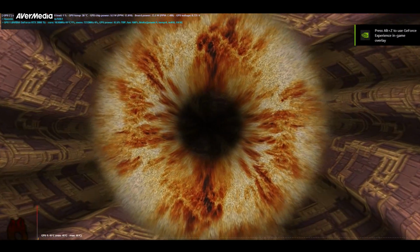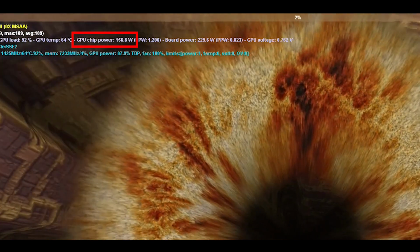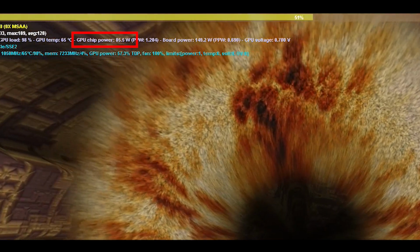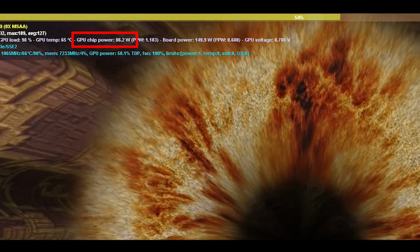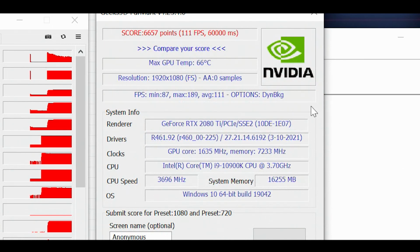A quick benchmark on FurMark will confirm the finding, and after about 15 seconds of the run, we can see the card's wattage consumption falls drastically and continues to do so to try to stabilize the memory heat. Frames per second fall in turn, giving us a score only a budget card should be outputting. Clearly, whatever cooling solution is under the hood is no longer working.